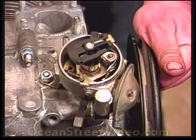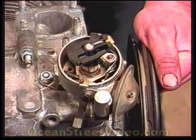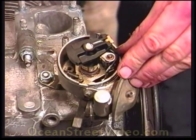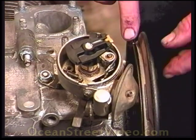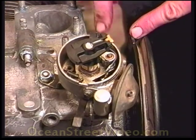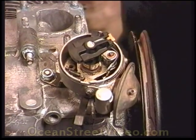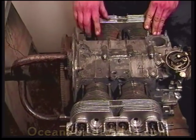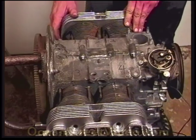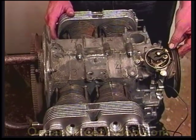We're right now at top dead center and you can see the distributor timing mark. The rotor is pointing at number one in the distributor, and the timing mark on the pulley is at top dead center right now. As good a time as any to set your valves — if we were to set them later it would be hard to show on camera because all the tin work would obscure the rocker arms. The easiest way, as you can see, we marked cylinders one, two, three, and four.